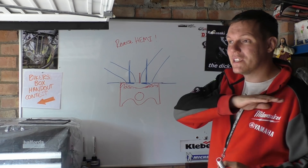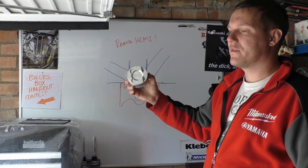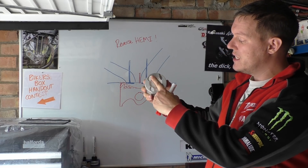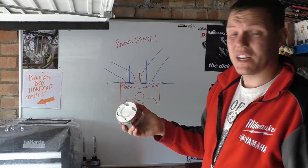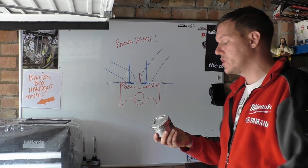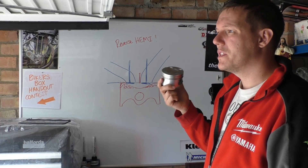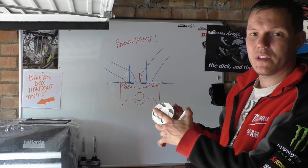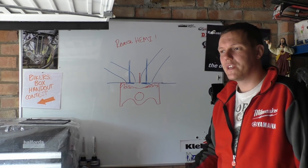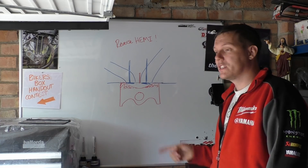That's why we try to make pistons as flat as we can. As you can see, this piston — apart from the relief so we can have overlap and all the rest of it — is pretty much bang-on flat. There is a slight recess in there, which is probably so you can actually lighten the piston even more and put a bit of your combustion chamber in here — but I think this is for a turbo, which is about lowering your compression ratio. So that's why they do that. Hope that makes sense. We'll do more on this if needs be, but that's why you don't do it.